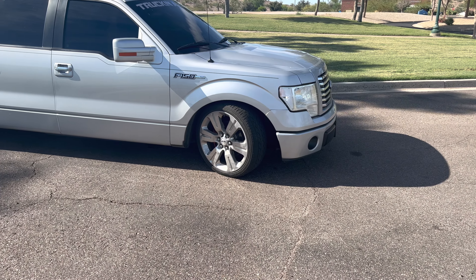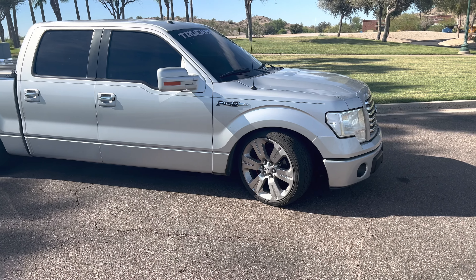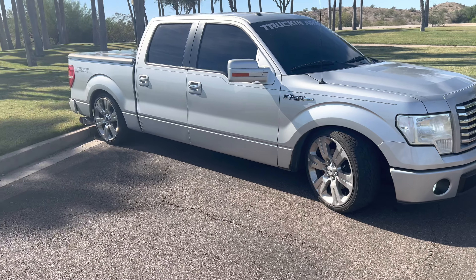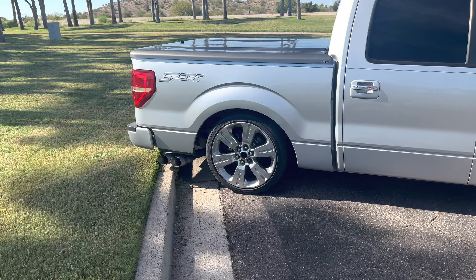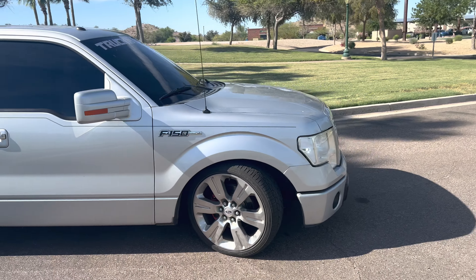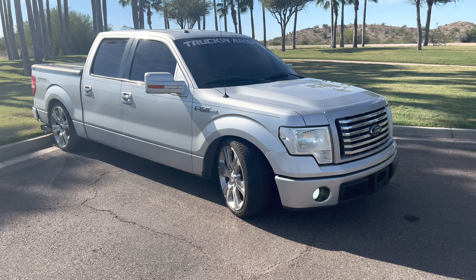For the crew cab guys — these crew cabs like to sit a little bit lower than the regular cabs, so just know that your lower control arm cross member where they grab onto it will also hit. That's just something to look out for. I still drive pretty carefully so I don't mind going extra slow. For the rear I still just have the flip kit and the stock shackles — it's dropped right now. I will be getting the step notch done in a couple of weeks. If you guys have any questions about these F-150s — camber correction, best drop kit — just leave a comment.